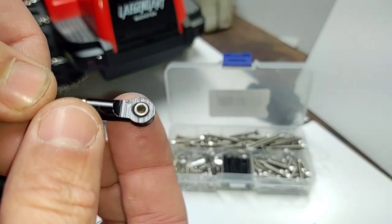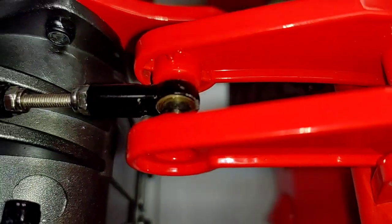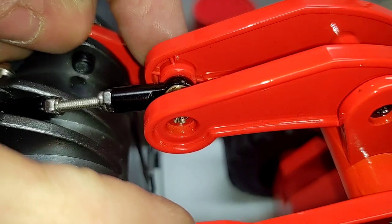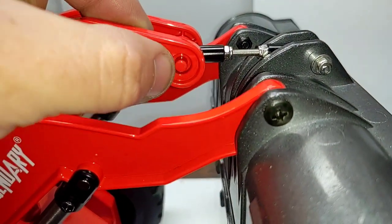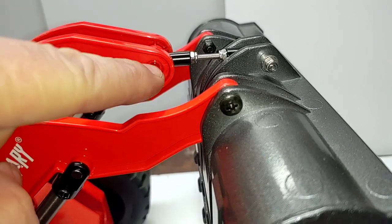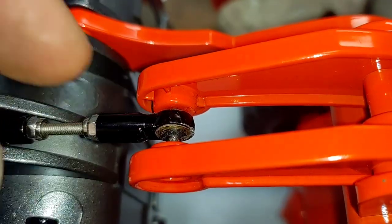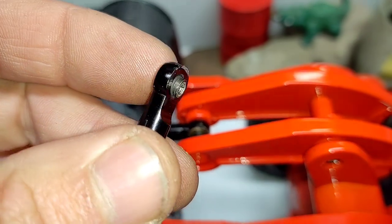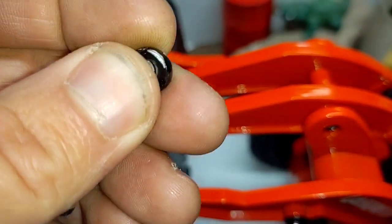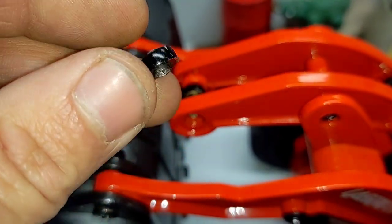For the upper portion, this part was a little bit difficult — well, not really too difficult. But you have to use your factory screw unless you decide to drill a hole right through the other end, because this is tapped out on the other end with a solid cap. So unless you plan on drilling it out and running a screw all the way through with a lock nut on the back, you're going to have to use your factory screw. In order to get that factory screw to fit through the eyelet, you need to remove the swivel out of the eyelet. That's held in with a small brass fitting on the back edge, so I used a pair of pliers to negotiate that brass fitting out and popped the eyelet out, then pressed the brass fitting back into the socket.